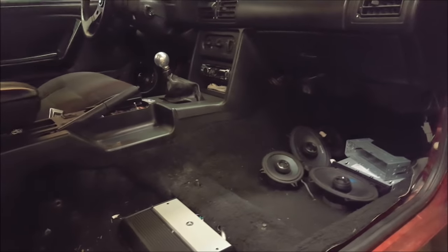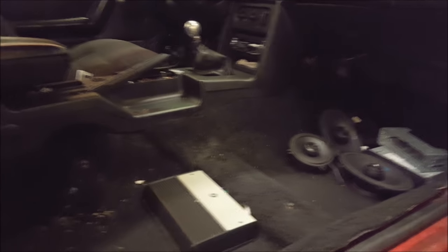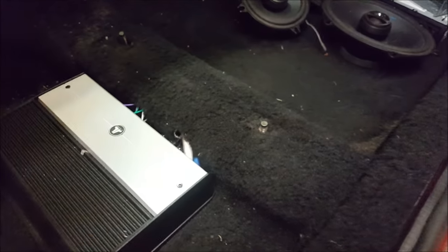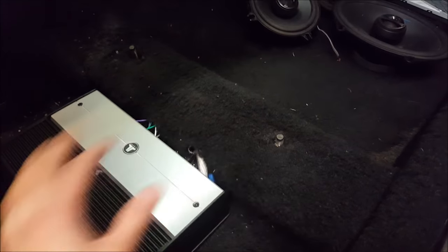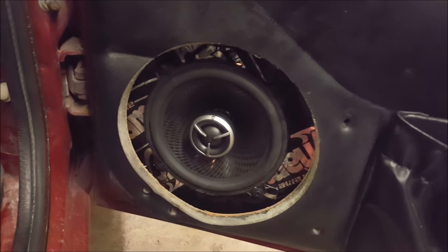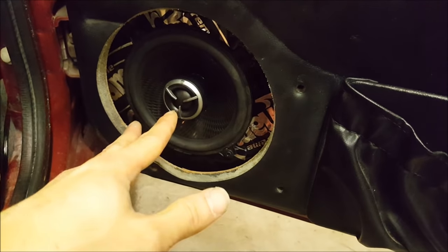I was fortunate that the customer is redoing a bunch of it so they had a lot of the interior gutted for me already — I didn't have to remove the seat or door covers. I just have to do my install. Here is our five-channel and I was able to run all the wiring nicely and tuck it up so when they put the seat back it will just barely fit — they might have to run spacers to bring the seat up just a tad to clear the amplifier. I went with factory sizing five-and-a-quarters and put Dynamat on the inside and outside skin to give the speaker a good foundation.